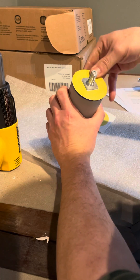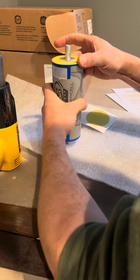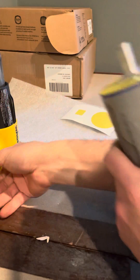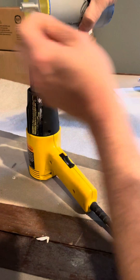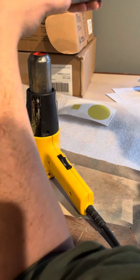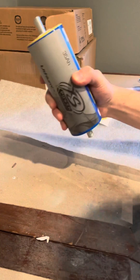This vinyl is repositionable. Take your thumb and run it along the edge. You're going to get wrinkles — that's why I can't wrap these all the way around. But one thing you can do is take the heat gun and smooth those wrinkles out. It's hot, but that'll make it look a lot cleaner.